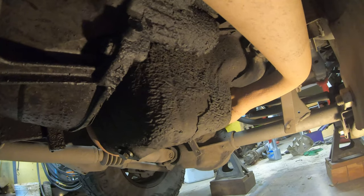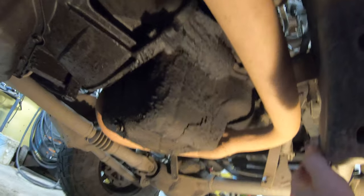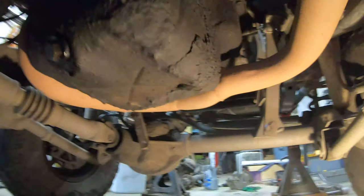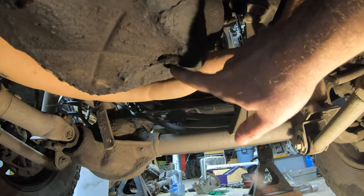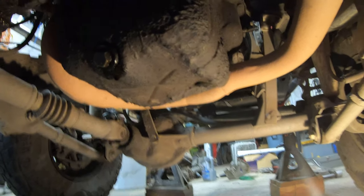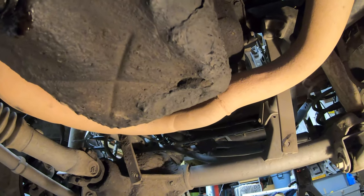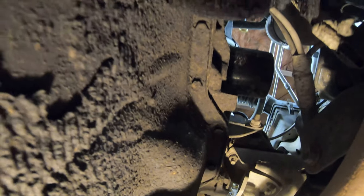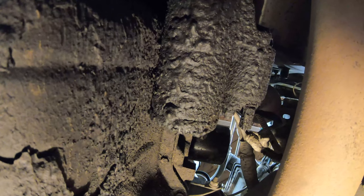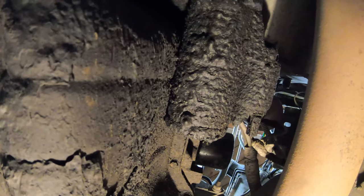So here we are under the Jeep. To get the oil pan off - it still had some oil to leak, so I put the plug back in. I expect there must be a pool of oil in here that was slowly working its way out. You can see there's a nice dent here - looks like somebody put their fist into it. That was one of the reasons I wanted to get the oil pan off to begin with. Up here are all these little bolts that hold the oil pan on. That grimy looking thing is my starter, and it's right in the way of some of the bolts, so that's got to come off.